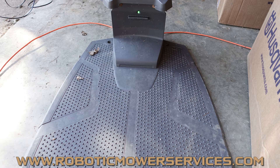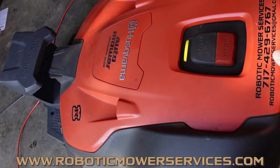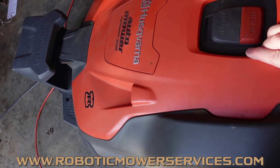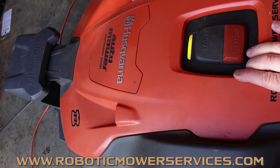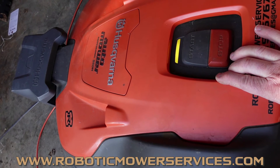You want to make sure that you have a green light on your charging station. After you have all that set up, push the mower into the charging station. On the 500 series mowers — your 520, 528, 550, 550H — when you push the mower into the charging station you should get an audible tone, and when you pull it back out you should also hear a different audible tone. That lets you know the mower is making contact with the charging station and everything is working. If you don't hear that, you have an issue with either your charging station or your mower and you'll need to figure out those issues first.